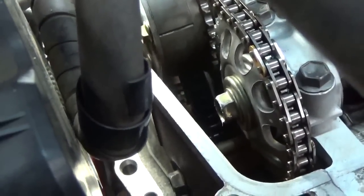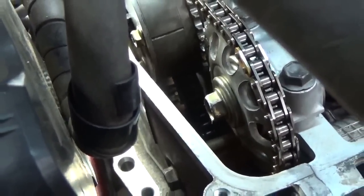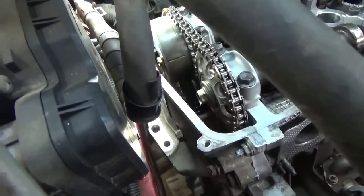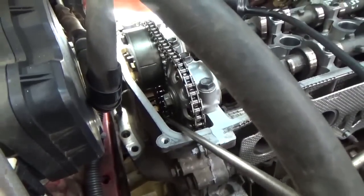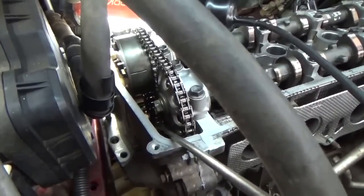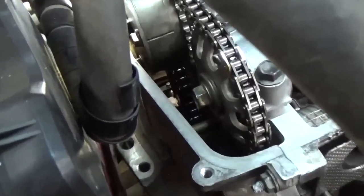So kind of give you an idea. I'm gonna go right down in there, like I said, with just a long screwdriver, and just gonna flick backwards on that shoe. It's kind of hard to see it with this lighting, but essentially we'll just release that hook and put tension on our chain. There it goes. I don't know if you heard it or not in the video there, but we can see